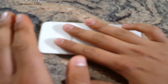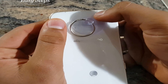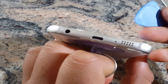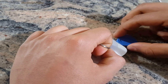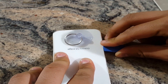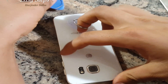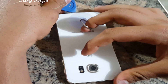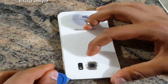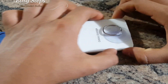Once the glass is very hot to the touch, you're going to get a suction cup. Place it at the very bottom, pull it, and it should create a gap. With that gap you can use a guitar pick — slowly, gently get it under. You're going to work your way around the phone. You should hear the double-sided tape coming off. Go to the other side of the phone and work your way all the way around until the glass comes free. Gently pull it up and work your way to the sides.